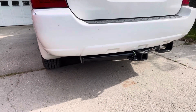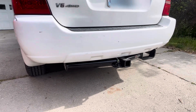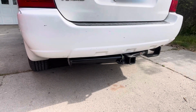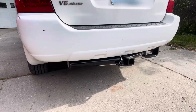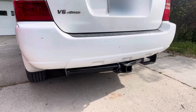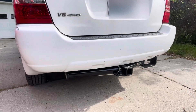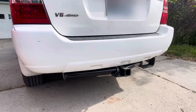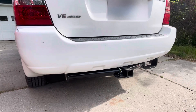For the record, I'm not being sponsored by anything, but these Curt tow hitches — it was plug and play, high quality. I'm really amazed at the quality. For anybody looking to put one on their Highlander: if you have the cooler equipped, it is plug and play. There are a couple plastic inserts you take out, but it's three bolts on each side and it bolts right up. I just watched a couple of YouTube videos and I've never done one before. It took me less than 30 minutes from start to finish — that includes taking the hitch out of the box.